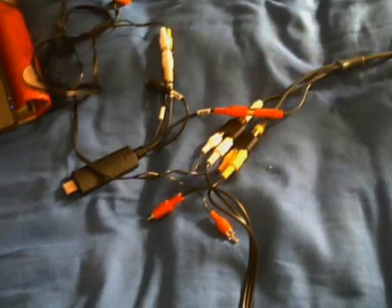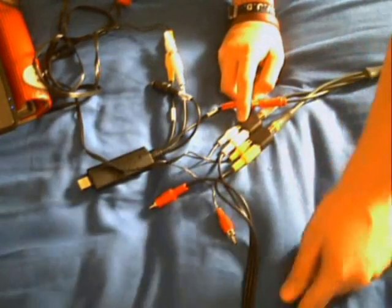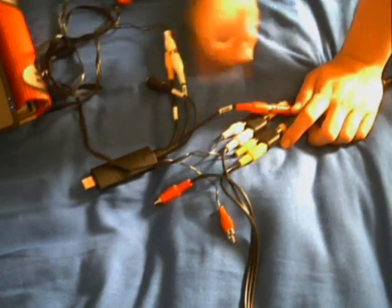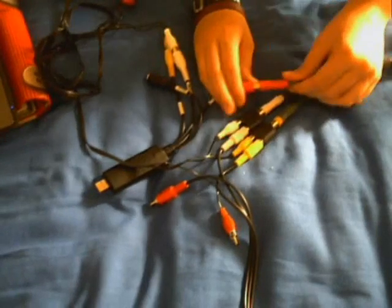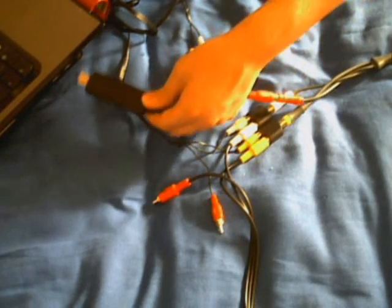So to summarize: you've got the cable coming from your console with two splitters on it, one composite cable plugged into the splitters, the other one plugged into the splitters — one of the composite cables goes into the TV, and one into the EasyCap. The spare red that you don't put a splitter on just plugs straight into the EasyCap from the console. When you've finished, just plug the EasyCap into your laptop.